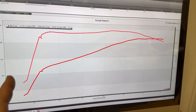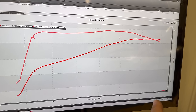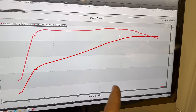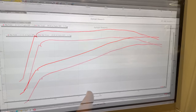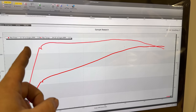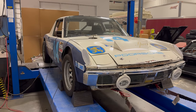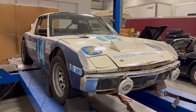But at least we're closer to that 200 number and not the 300 number. I did rev the engine up to 5,500 RPM. This is probably the first time the engine's been revved like that, at least under a load, so I didn't want to explode everything to bits right off the go. But it was making its maximum horsepower at 5,100 RPM, so we well exceeded where it was making its maximum horsepower. Being just 17 horsepower over what you should probably be putting through this transaxle, I feel pretty good about this car.